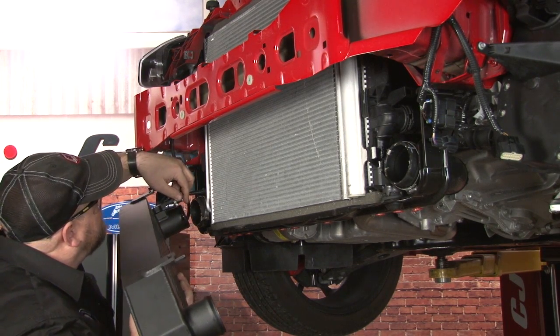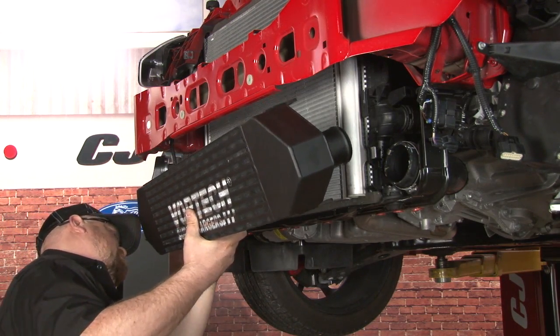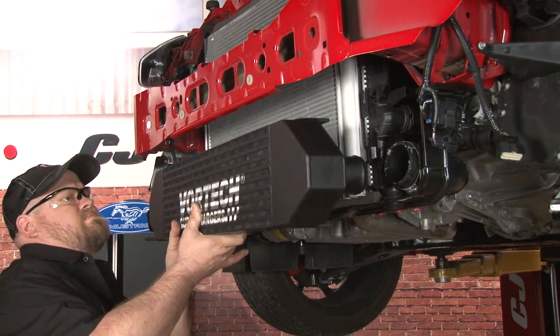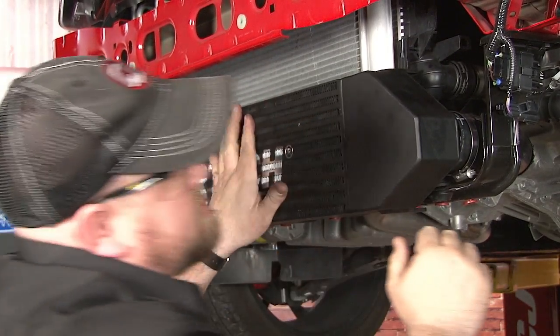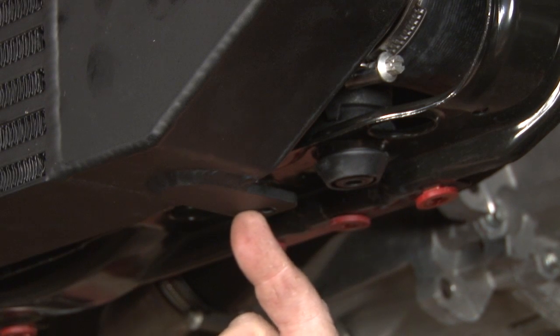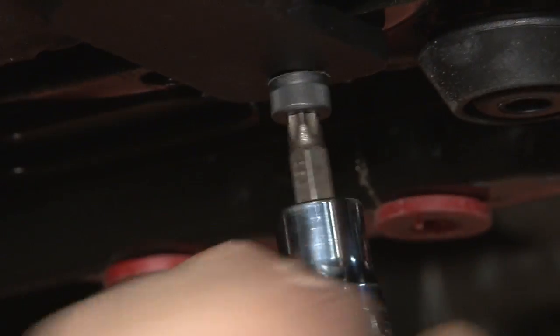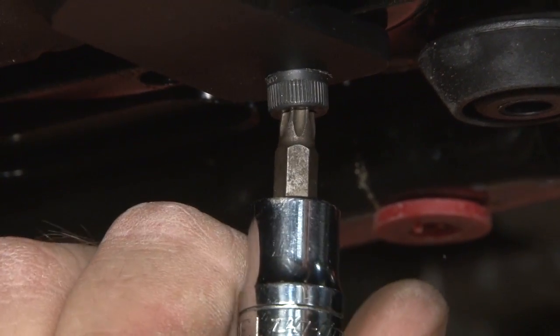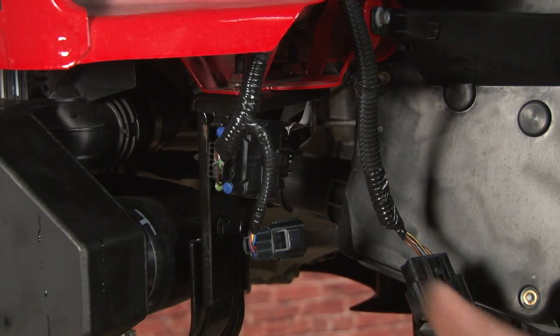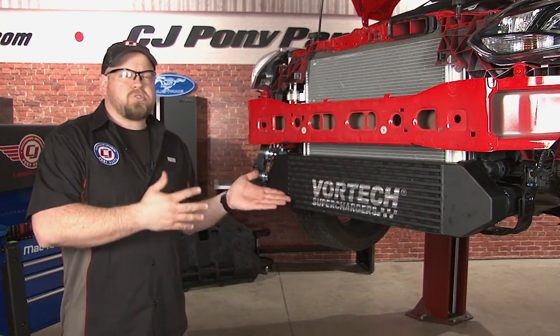Start the install by reconnecting the MAP sensor. Get it up into place, making sure it goes up underneath the factory bracket. Hose is connected on both sides, then we'll tighten them down. Now using the supplied hardware, we can connect our intercooler to the bottom of the radiator support — you basically have to put the nut up on top and then thread the intercooler into it. Since we're not planning on reinstalling the shutter system, we're going to take the harness and just tie it up out of the way. That's pretty much it for installing the intercooler on the car.